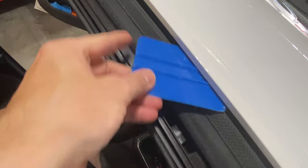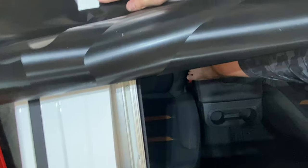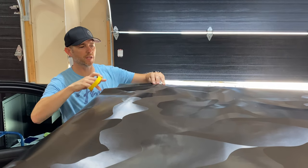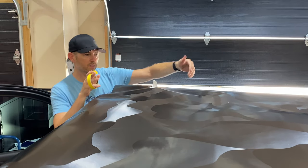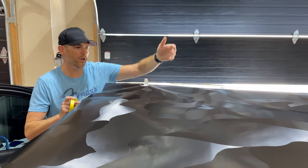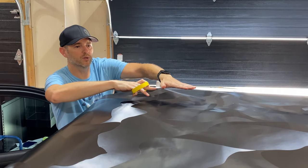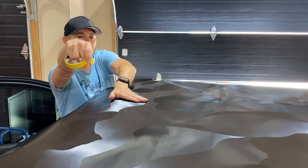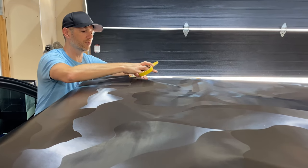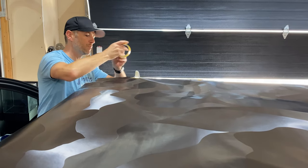There's a flap that helps divert air when the sunroof is open — we've got to make that stay down, so I'll wedge my squeegee in there. There's the cutout, and I've left enough material to trim down after I heat up the wrap and lay it in. I'm going to anchor down a couple of spots on the sides to make sure the orientation is right, then cut a smaller hole just big enough to stand up through the sunroof and work that area first, then stand in the box to do the rest.